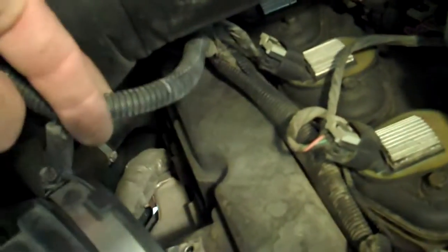Once you've gotten all that done, give it the wiggle and wiggle it off. There's an electrical wire in the back that is clamped onto it, and the air box just lifts right off. There's the air box, there's the clamp that held the electrical wire, and there are your six coil packs.